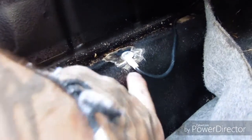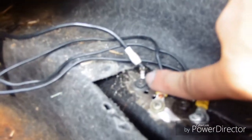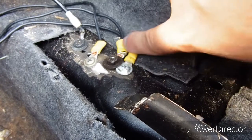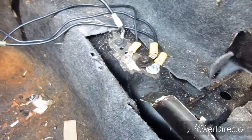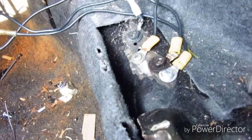All right, guys, right off the bat, let me show you something. On this side, I have one ground. This ground is for this compressor. Actually, no, this is the other compressor. Look at this ground right here. It's overlapping this one, and it's not even fully on the floor. This is probably going to the ECU, my guess. So I'm gonna take this out, drill a new hole, and find somewhere to run it, maybe up here, and we're gonna test that, because that looks pretty jank. Eventually all this will be really good, guys, so bear with me.